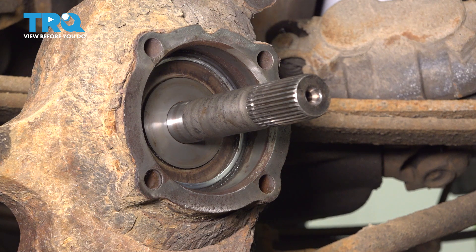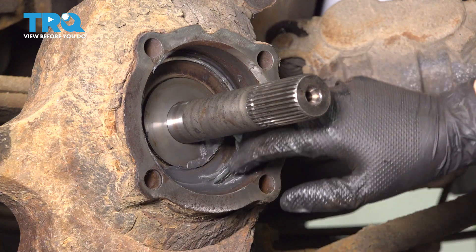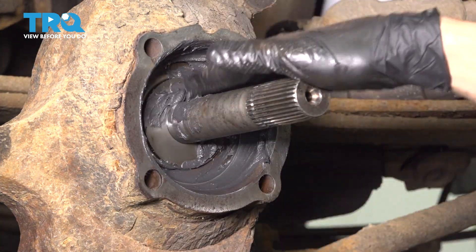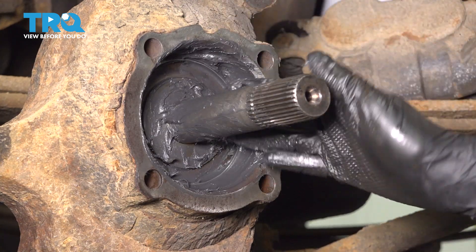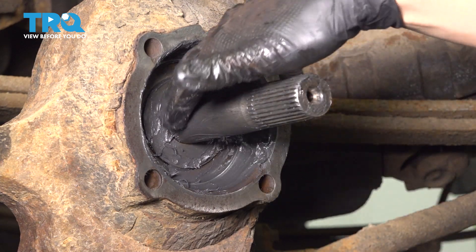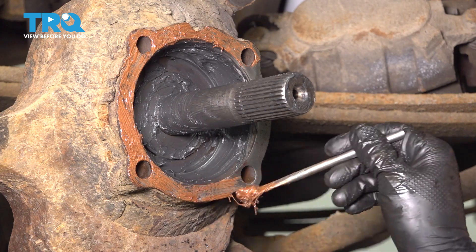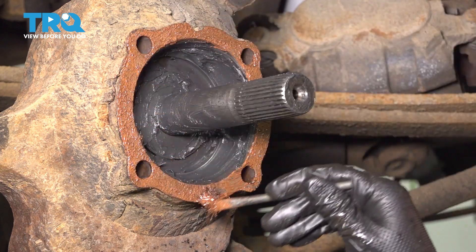I'm going to take a clean glove and pack this with some grease. Make sure you use grease that's rated for wheel bearings. Get some on the axle shaft as well — it does ride on some needle bearings right about here, and some on the splines. I'll add some more on here later, but I just wanted to give it a thin coating for now. On the outside, on the area you cleaned, apply some anti-seize. You can use grease if that's all you have — it's better than nothing. Basically, you just don't want bare metal so that it doesn't continue corroding and rusting in the future.